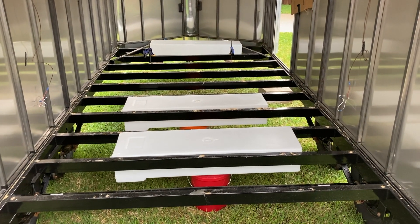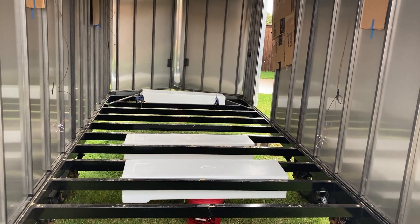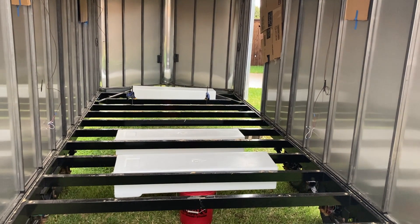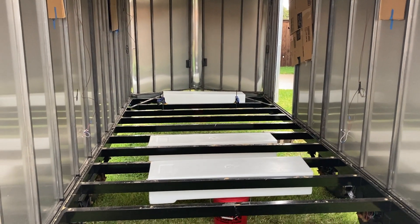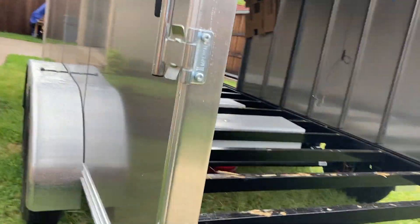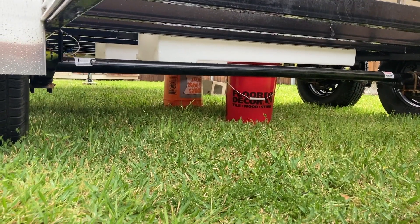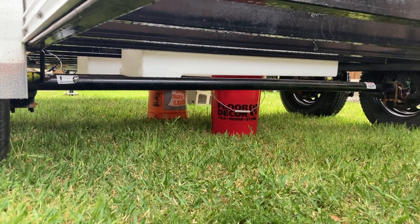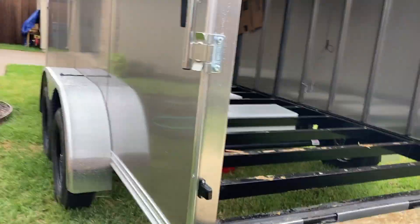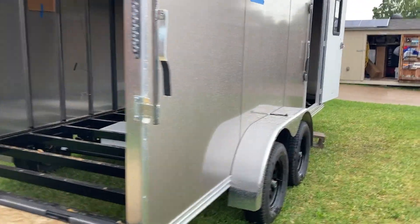By keeping the tanks only 8 inches deep I'll have enough clearance. I'll get a view from the bottom side — the front tank I want up higher because of just the way the trailer is pulled and how it may go over bumps. The center two tanks are right over the axle. If you look closely you can see the tanks are above the axles, sitting about 4 inches below the bottom of the trailer, right over the axle area, so they'll clear most things even when the axles come up. There's quite a lot of travel distance there.